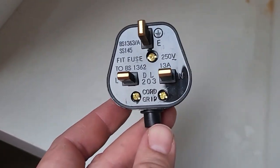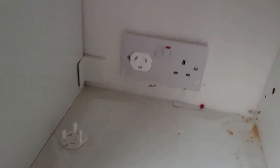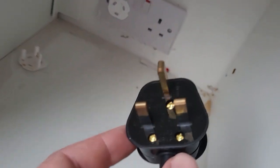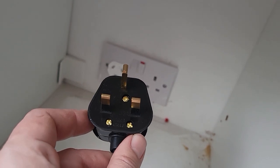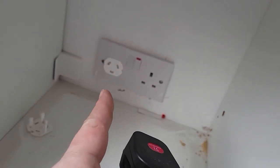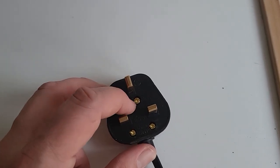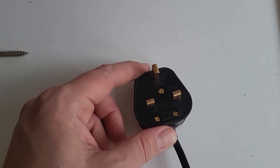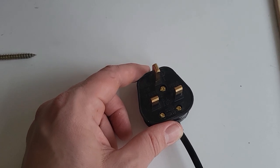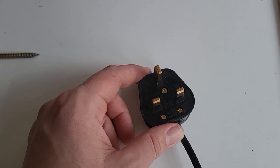So what you're going to be doing is taking this plug apart, taking the wire out of the plug, and then feeding the wire through the hole. Obviously, you need enough space on this side that you're going to be able to rewire the plug - you don't want to have not enough wire left. If you're not happy with this and don't feel confident taking wires out of a plug and putting them back in, then do seek electrical professional advice. It's not that difficult, but if you're not comfortable, please do seek proper advice.